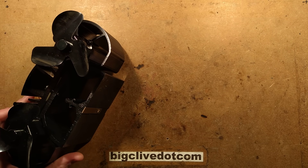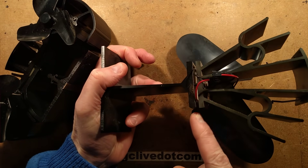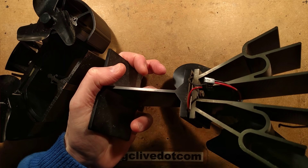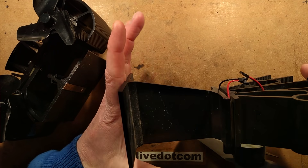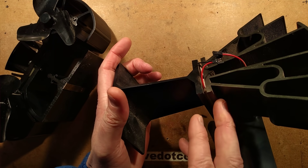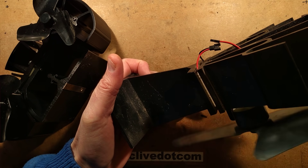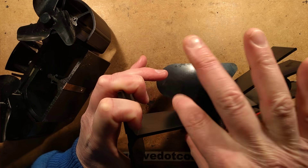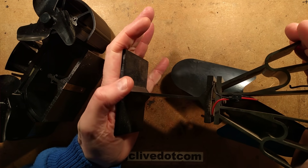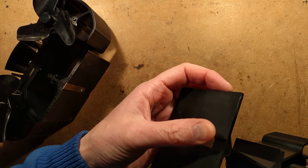I'll show you the more traditional version which looks like this. Much bigger fan, it has the base here and then there's a joint between the lower base and the upper section. In between that is sandwiched a Peltier junction — not just a Peltier junction but a whole array of Peltier junctions, a Peltier panel. When this is placed on a stove it heats up and the heat gradually spreads up, but there's a thermal differential across it. When it's hot enough there's enough of a differential and it's generating enough current, the fan starts spinning. It effectively self-cools the top end while the bottom is supplying heat from the stove, and that just keeps it running.